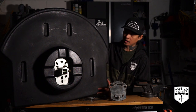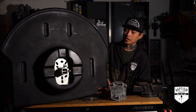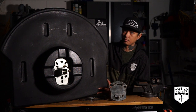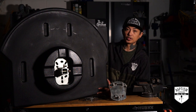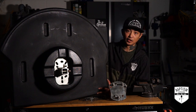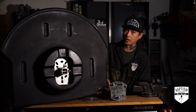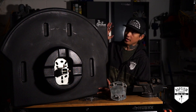This thing is pretty stout — it carries 12 gallons of fuel. When it's dry, it weighs about 15 pounds. Add in about 12 gallons of fuel at 7 pounds a gallon, that's about 85 pounds, so altogether this will weigh about 100 pounds. I do not yet have a reinforced tailgate hinge on the Jeep, so I know I'm going to need to upgrade that, especially if you're adding 100 pounds of fuel plus a spare tire. That's going to kill my hinges very quickly, so I'll need to get a stronger hinge or upgrade my rear bumper with a tire carrier.